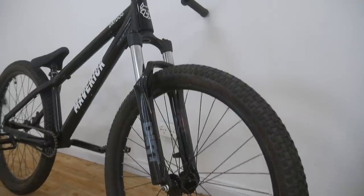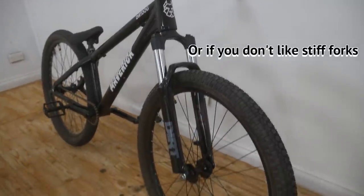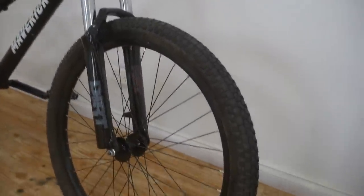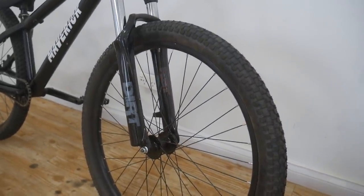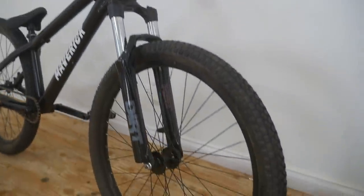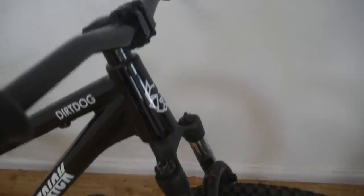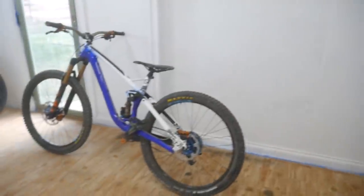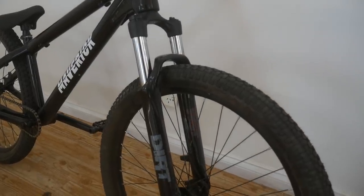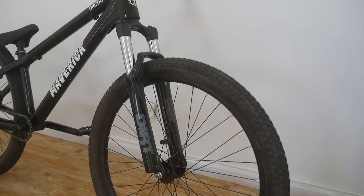Moving on to the RST dirt forks. This is going to surprise a few of you guys but I actually reckon these aren't too bad. For a younger and lighter rider these would feel really good. The main thing I don't like is they don't have a thru-axle, but that would obviously bring the price right up. They feel weird for me because I'm really used to stiff forks — the adjustability is pretty good but they just don't allow you to set it hard enough. I actually have the suspension on my trail bike set harder than what this one allows.